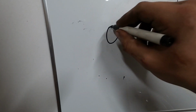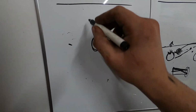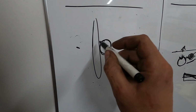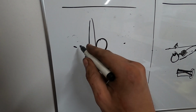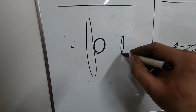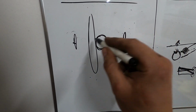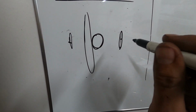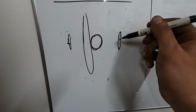Okay, so essentially here's your pinion gear, right? And then this is going to be the space right here that we're shimming, and the space right here that we're shimming, and then that's going to be your ring gear right there. Okay, so the hardest part, I didn't take the pinion out, so we don't have to worry about the pinion depth. But the hardest part about getting this in is setting the preload on the bearings over here, which basically means you don't want the carrier to sit in here and be able to rock back and forth. You want it to have some drag as it goes into the carriers.